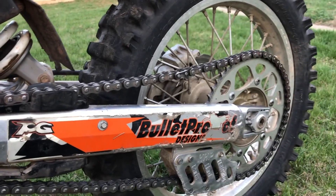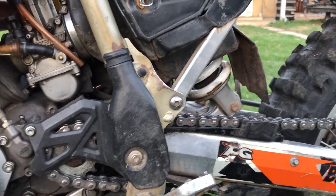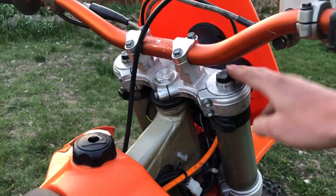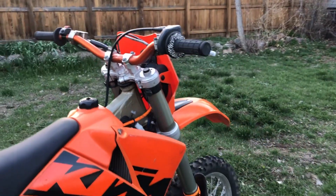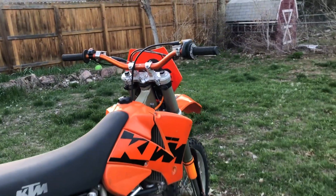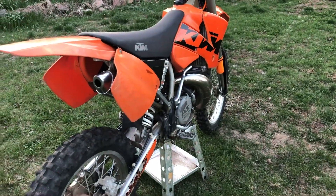Chain is in good condition — I also got a new chain with it. I also got another rear spring so I might go ahead and check that out. I haven't set up the rear suspension for my weight or anything. I only did that on the front because I rebuilt the whole system. I actually have the rebound set to comfort mode, which is 14 clicks out from all the way in. I'm primarily doing a lot of rocky roads and the handlebars jiggling around isn't the most fun for my hands, so I went ahead and put it in comfort mode.